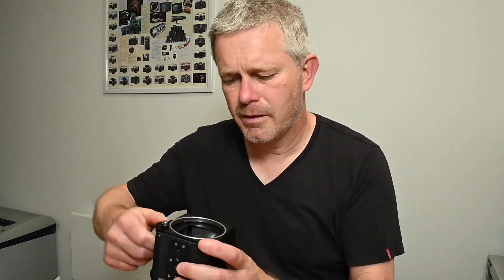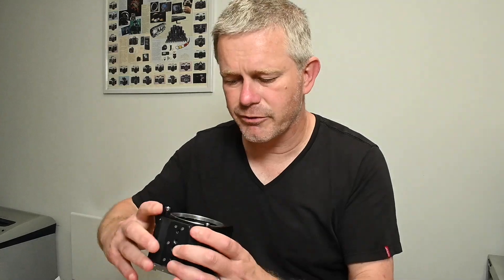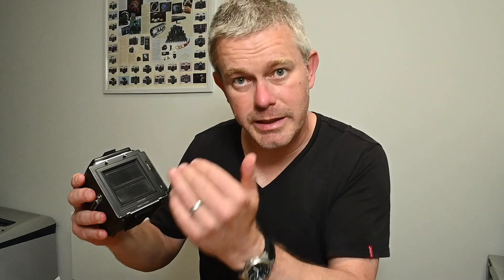One quick thing you could do is plug a flash into the little sync socket and make sure the flash sync works. That little socket often gets a bit mucky and can impact flash synchronisation. At this point, move on to the camera body. Just have a look inside — take the lens off and fire the camera. Make sure the mirror is going up as it should, clearing the film gate and going right up to the top. Look at the back and make sure the two blinds are opening and closing. Often on Hasselblads that need servicing, those blinds only go up partially — if they're only moving up partially, the camera needs a service.